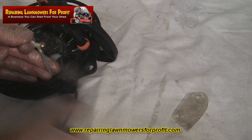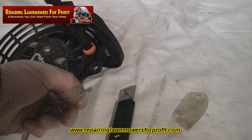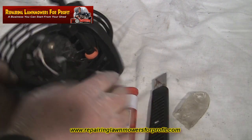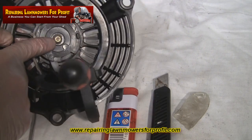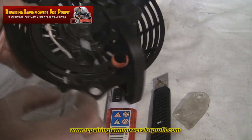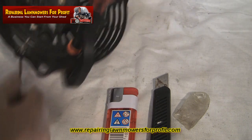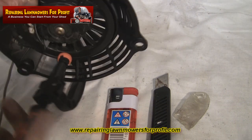So let's say that was cut off — you just burn the end of the starter cord here, create yourself a nice end, just burn it so you can push it back through. Turn it six full turns against the spring, basically pop your new cord through the hole here, line it all up, make sure you've got a nice tight knot, and pull it back through. Then take off your clamp.